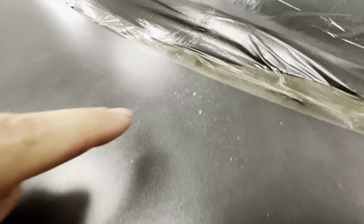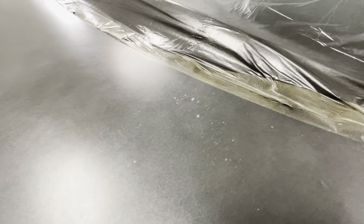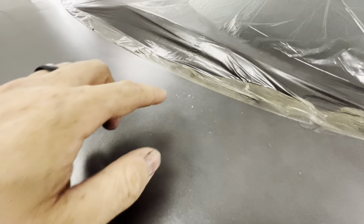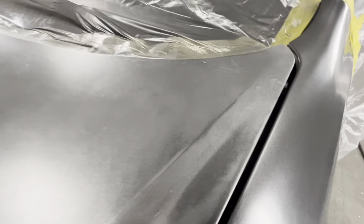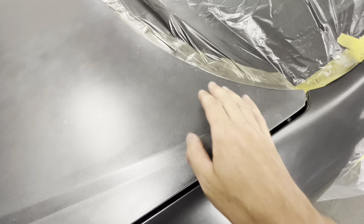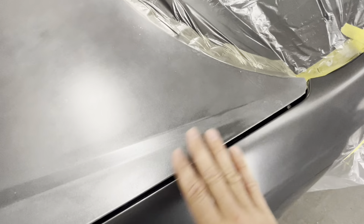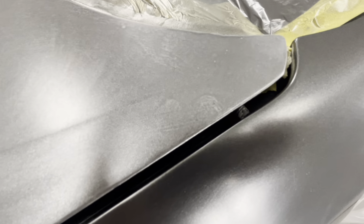This is gun spitting. I did not filter this paint and it's old, so it's got clumps in it. This also is contamination. This almost looks like when me and Eddie picked this hood up — maybe grease on our fingers got on it and smeared. But either way, these are all forms of contamination. If you see this in your paint, this is what you're looking for.